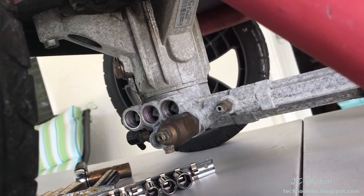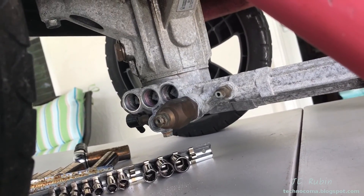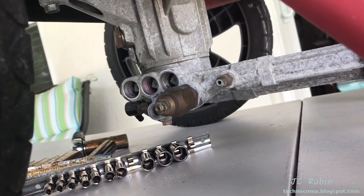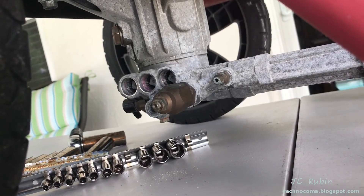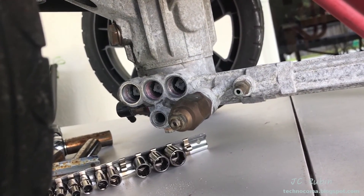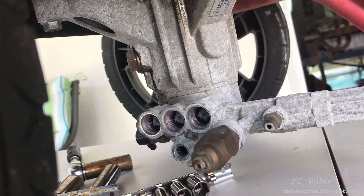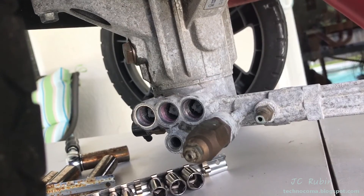I started loosening and removing the brass fittings from the pump while the pump is still in the unit. In making these videos, sometimes the best vise you have to work with is the device mounted in the unit itself — these things are not exactly coming out easy. I removed these three. You can see the pieces I'm going to be pulling out shortly, and I did open very slightly the brass plug up top to see that some oil came out, which lets me know this thing wasn't running dry.